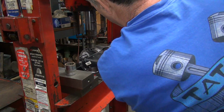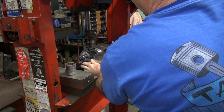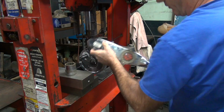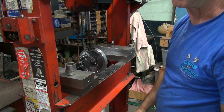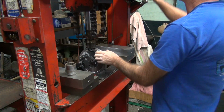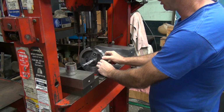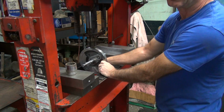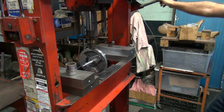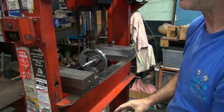Okay, what do we got here? There's 100 right there. There's 120. About 150 again, stop. It's still rising, but at some point it goes into yield and it doesn't get any more torque. You don't want to torque into the yield point because that means you went too far. You've lost the strength of the hardware at that point. So just before yield is maximum. The only problem is you don't know where that is. You can just kind of feel it out.